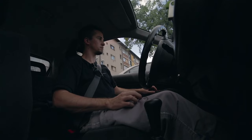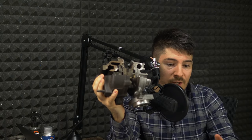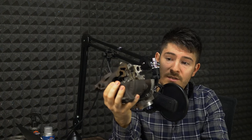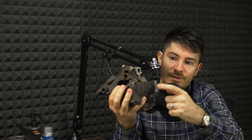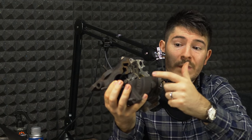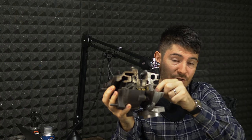Tip number three: don't switch off the engine immediately after driving aggressively. If you drove on the highway, drove aggressively, or just had some fun near the redline, do not turn off the engine immediately — because your turbo is really hot. In some cases it may even glow red on the exhaust side, with temperatures that can reach 1,000 degrees Celsius. If you turn off the engine, those hot gases will carbonize the oil that is meant to protect this shaft.